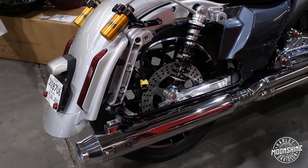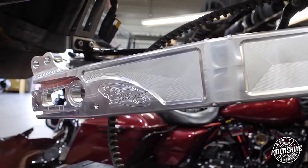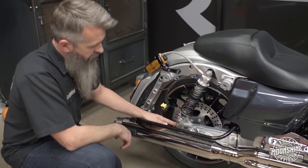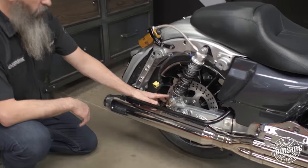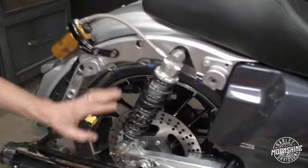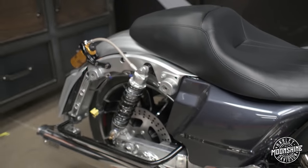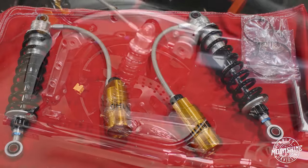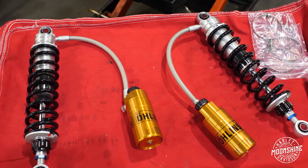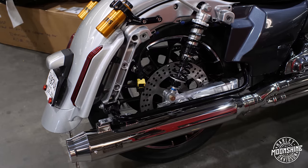On the rear end of this bike, because of all the power, we need rear axle adjusters. On this build, the owner chose to go with a brand new swing arm instead of what we would typically run, which would be the Krauss Vector 1 axle kit. When we run an aluminum swing arm, we have axle adjusters right here to pull and hold the axle back. This swing arm has two options to mount the lower shock — factory geometry and an additional forward shock mount that lifts the bike another three-quarter inch. We went with the factory location because it's a 13.25 shock already with a little adjustment on the bottom right from Ohlins.